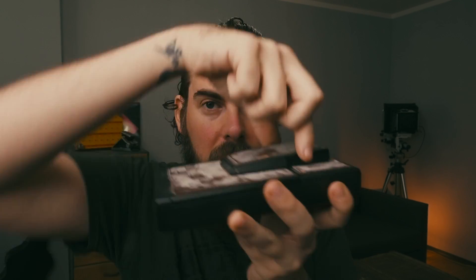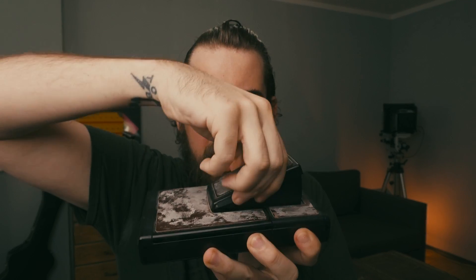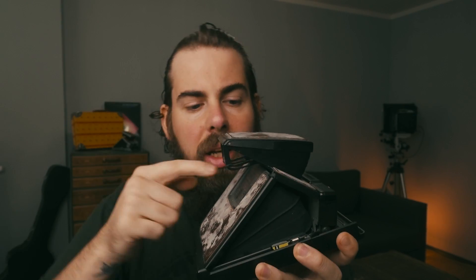On the top here we start removing, but on the viewfinder keep it still while you remove because otherwise it will maybe break off. Then we remove the parts down here by going around the viewfinder. Then we really watch out when we work on the viewfinder — we open the camera a little bit and see how many parts there are that we need to remove.